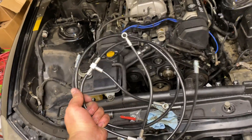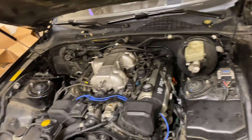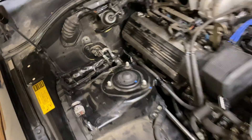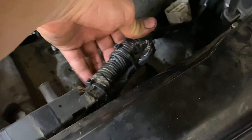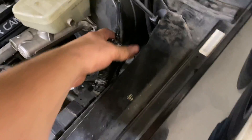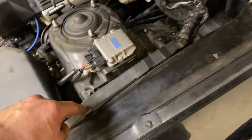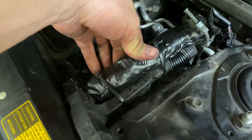So that'll be the next step: get the car off the ground, get under there, get that all torn out and squared away. As soon as those lines are done, we will bleed the whole system and the brakes will be done for now. This bundle of wires here, I just taped up and zip tied for now. Over here, once I depinned and wired up — I have this little bundle of wires all taped up under there that all dealt with that module. I still need to tape this one up too because he's not used anymore. This entire harness running along here is now literally just the fluid level sensor, and this entire massive chunk here is just for that one component.